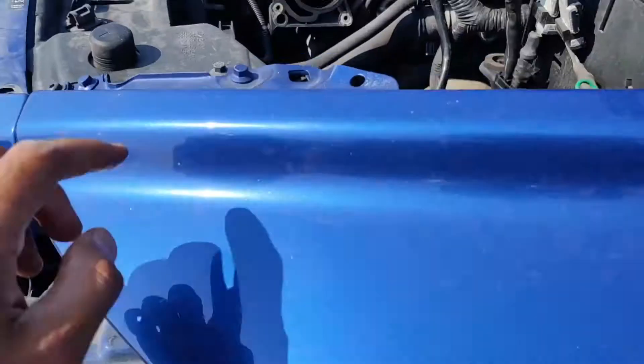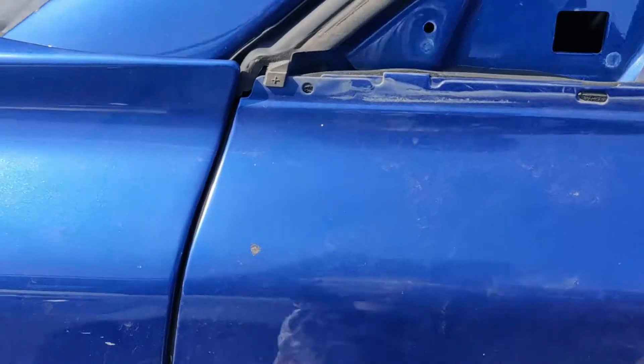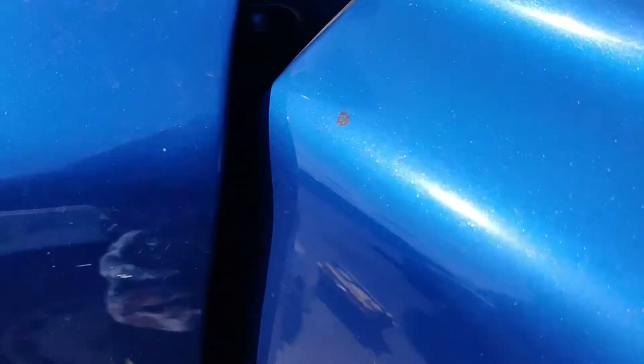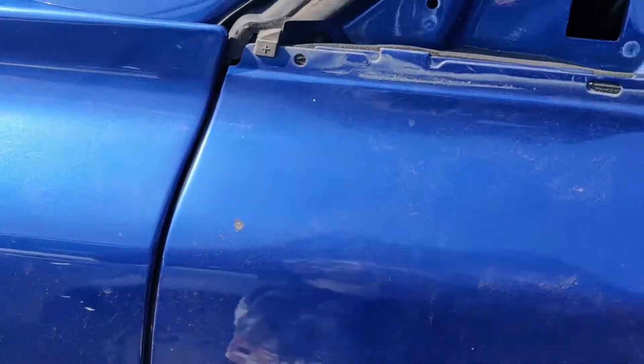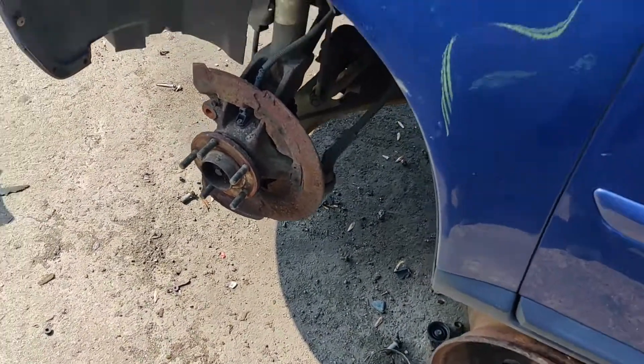You don't need to remove the whole bumper, but you just need to remove these clips — one, two, three, four, five — so that you can move the bumper a bit. There are a few screws here that you can remove, and then three more, with one hiding inside the door. You can see it's hiding right there.